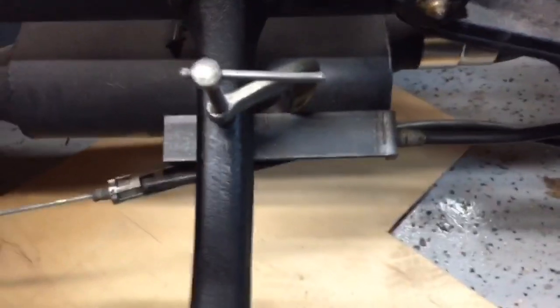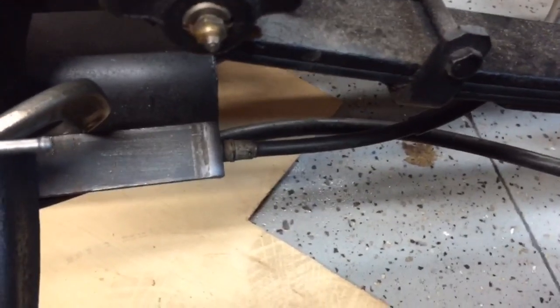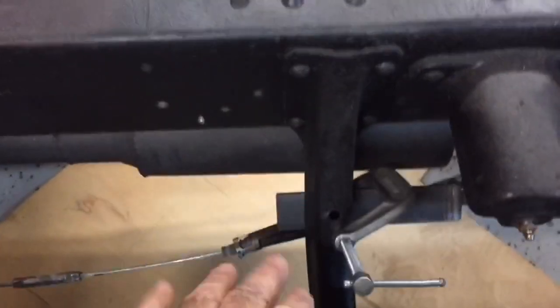I have my bracket clamped in a temporary position here. I've got enough slack on this cable housing so that when it pulls, it's going to straighten that out some to tighten that driver-side brake, and I've got enough clearances. Here's the position of the running board, so I've got this whole open area. Up front where the original brake handle is, it goes through the floor and was originally routed inside the chassis and then through the cross member, but I changed the routing so it goes on the outside of the frame and it will be underneath the cab.